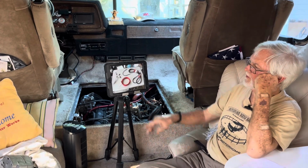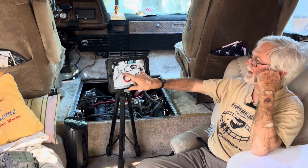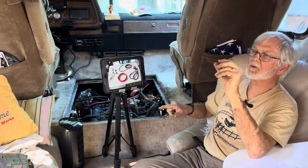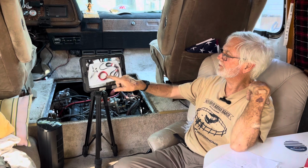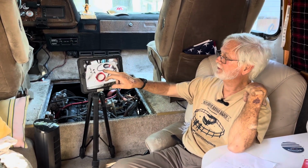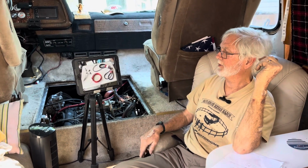This is the kit. He's got the bracket, new swing bolt. There's a spacer that you'll need, and then here's his adjuster part. 2-gauge cable. We're also putting a ground wire cable on it too, because you've got 200 amps possible coming in, and 200 amps that could possibly go out. So we put an additional ground cable on this thing.